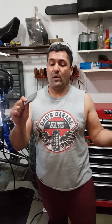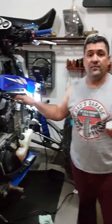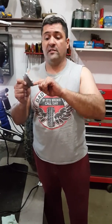Banshee Fever 750 — one more tip of the week: how to make PAIR small block-off plates. You can do this for the Honda 450Rs, the Raptors — this can be done to anything. All you have to do is take the original one off and make a template out of quarter-inch aluminum. You can use eighth-inch if you want, but I feel better with quarter-inch so I get no flex. Because there is some pressure coming out — it's tied into the cylinder. There are two holes tied into the exhaust cylinder, and if you're running a super trap like I am, it creates a little back pressure. That's why I wanted quarter-inch. Then I'm going to use silicone RTV gasket maker around there — just a little bit — and that'll button it up.